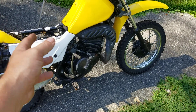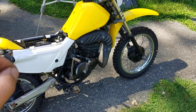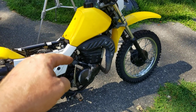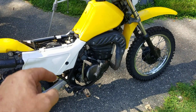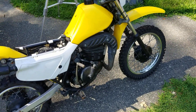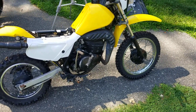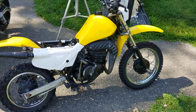On this one it's got oil injection, but if you didn't want to run the oil injection you can just delete it and pre-mix. I think that's what someone did to this bike — they pre-mixed it but left the oiler hooked up. So when you leave the oiler hooked up but run a pre-mix and your tank runs dry, it sucks air, and air creates a lean condition. That's what caused these bearings to burn up. They realized they were out of oil, topped it off, but it was already too late.